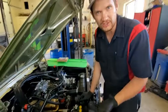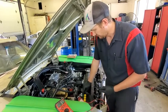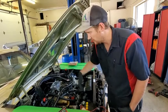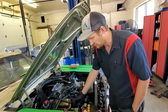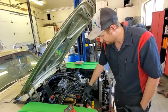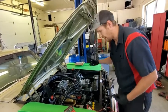One quick little trick to indicate a charging problem: you can actually disconnect the negative battery. If the charging system is fine, the voltage produced by the alternator is enough to keep the vehicle running. But if it's not charging and you're relying solely on the battery, the engine will just die. As soon as I disconnect this negative battery, it dies — so that confirms I have a charging system problem.